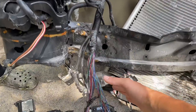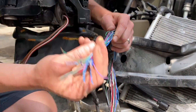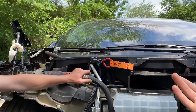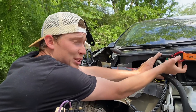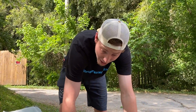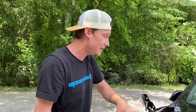Back to the damage area, we found some wiring issues. This is going to be some pretty serious wiring work - there's a missing clip, and it could have been a firefighter chop right here. Whenever these cars get in a wreck, firefighters actually cut a wire so nothing keeps running, or they can just unclip it and pull the clip out. Also, there's some sort of fan that keeps cutting on and off in here, sucking air in. The filter it's connected to is insane - it's on the front area we pulled off. It could be a fan that blows air to the batteries or the motor.